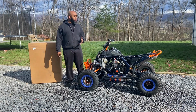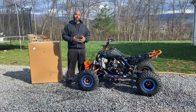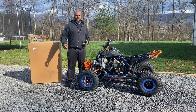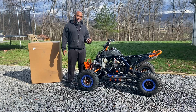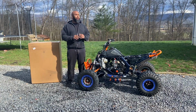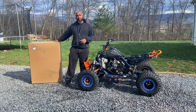In the last video, what we did was make some changes to the Power Commander so we could make sure we were able to get it proper fuel. We didn't want it lean, we didn't want it rich, and after a couple of rides and checking the spark plug, I did find a happy medium where I feel like it is really good. I'm really excited that's the last thing I needed to do before we put some plastics on.